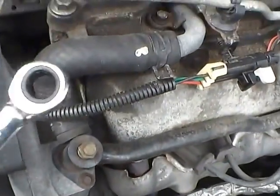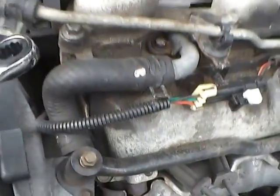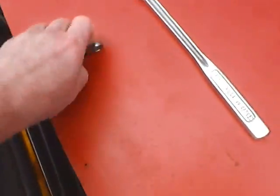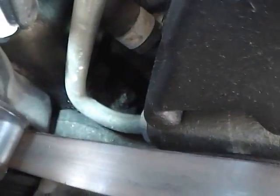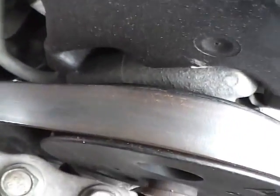You can actually take this wrench at an angle and fit it underneath the pump and onto the head of that bolt. This has about 12 positions in the ratchet, so I was able to tighten it almost one full turn. The one in the back — I used a regular combination wrench, coming in underneath the belt, and I have it on the head of the bolt now.